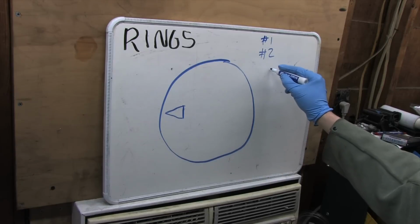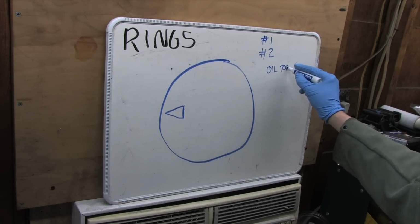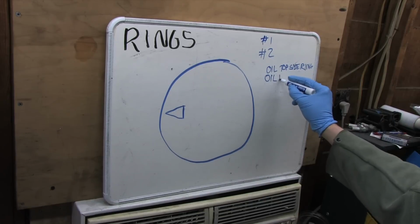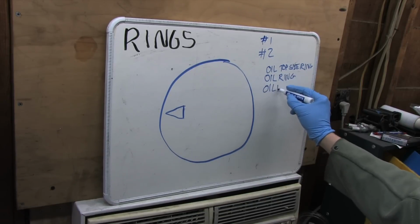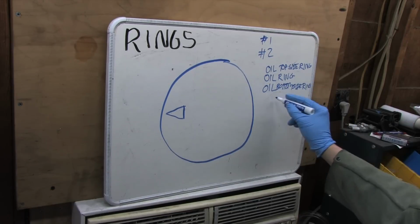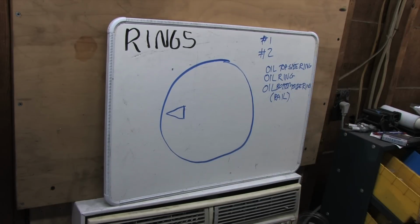You got 5 rings to deal with and you know which ones they are by now. There's a top one and a bottom one for each kind, excluding the corrugated looking oil ring. If you hold the piston so that the arrow points to the left and treat it as a dividing line, the top rings all go on the top, the bottom rings all go on the bottom.